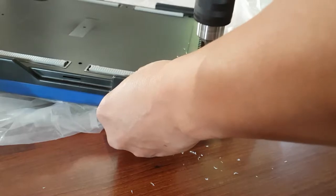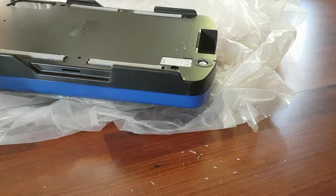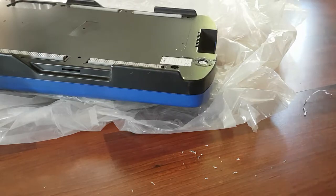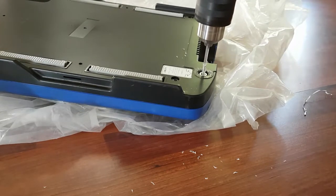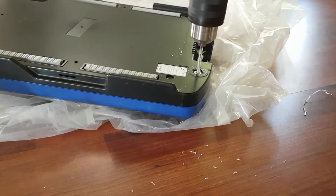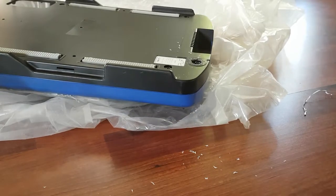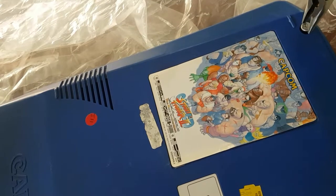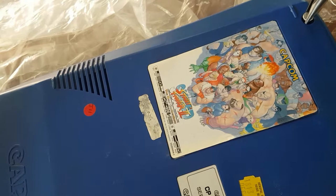Here I'm taking this drill, taking one of the drill bits that I just showed you, and I'm trying to open this game cartridge. To open an original one — which this was from eBay — it will have these Capcom security bolts through which are a complete bastard to remove. So you have to drill through it to actually break this security bolt. Then turning it with a pair of pliers just to try to get this off.